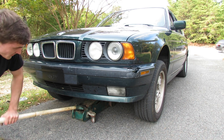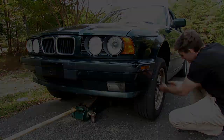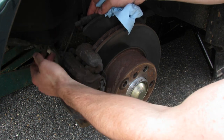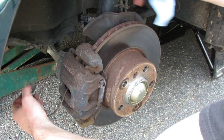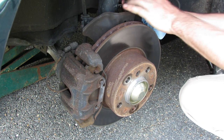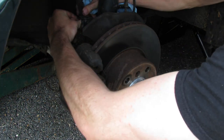You might need to lower the car onto boards. Once we've lowered onto some jack stands, we can spin these lug bolts right off. Our next order of operations is to remove the brake caliper to free everything from the strut assembly. I'm going to start by unplugging our brake wear sensor so we don't risk breaking that later — it just pulls straight out. These little rubber grommets need to pull out from the strut assembly; a little silicone spray or WD-40 will help. Then we remove the wire for the brake wear sensor and the wheel speed sensor wire.